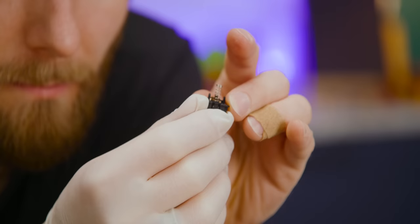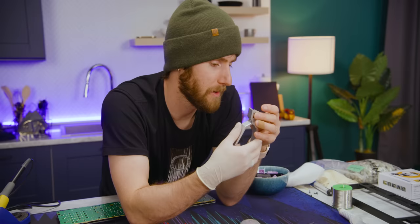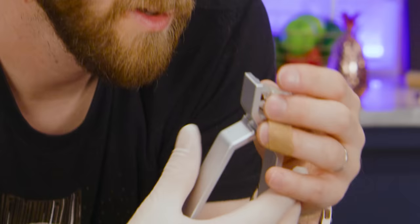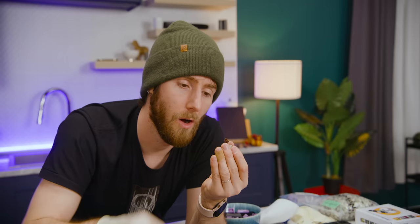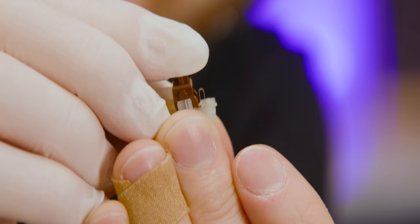Beep, beep, beep, sending messages across the Atlantic. Sorry. Let's grab one that is confirmed actually working and assembled correctly for this next part. Oh wow, yeah, that one is borked. Because here's how it's supposed to go down. So it goes down, there's your tactile bump, ba-doop, ba-doop, and then there's your contact point right under it.